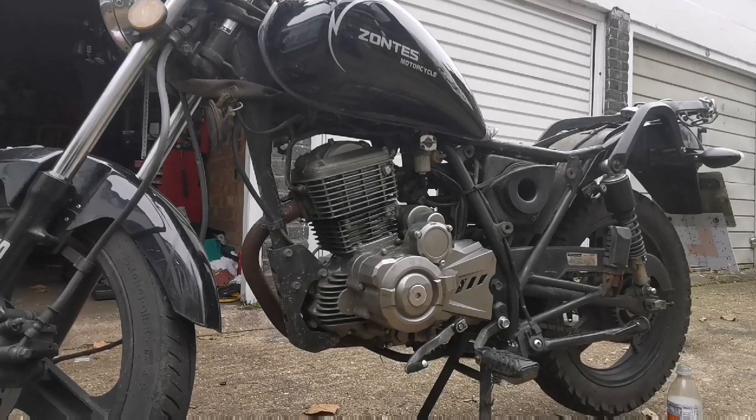Okay, so guys, I'm kind of down to just, well, I don't know. I think now the tank needs flushing, so I'm going to have to just tip all the fuel out. I'm going to have to keep sloshing it, try and get all of the rust out with it, and then I'll just have to top it up with fresh fuel. I'm going to drain the fuel from the carb as well, so that it all starts fresh.